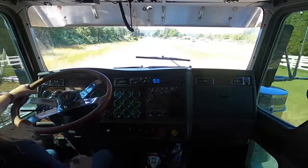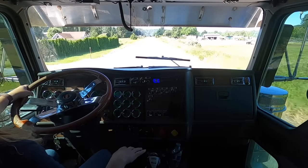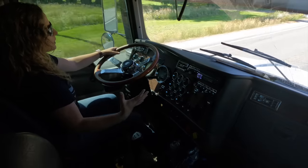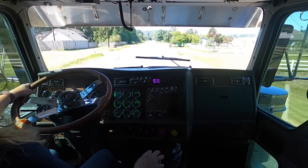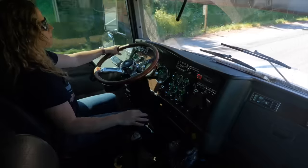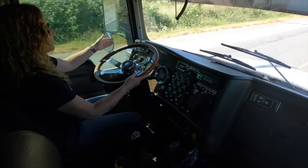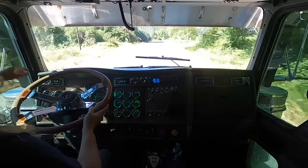Another reason why I've avoided making this video is because I have a tendency to shift without thinking. I don't look at my RPMs very often and I don't look at my speedometer very often. When the truck is loaded I can pretty much feel how fast it's going and what gear it should be in. I usually spend my gauge-checking time on things I can't feel, like water temps and oil pressures.